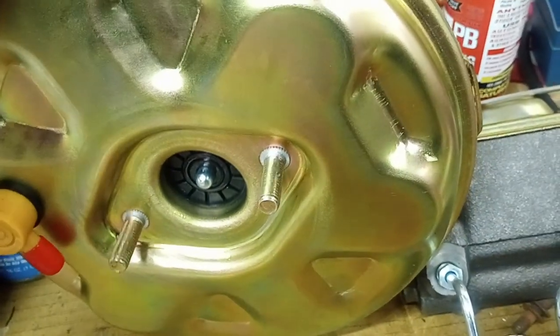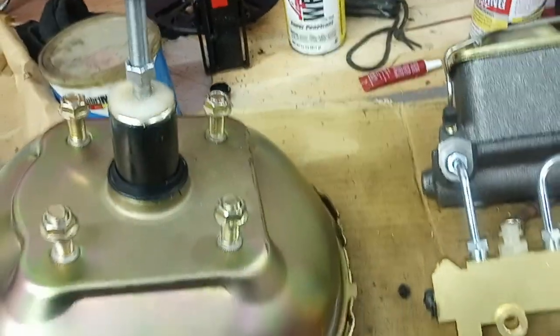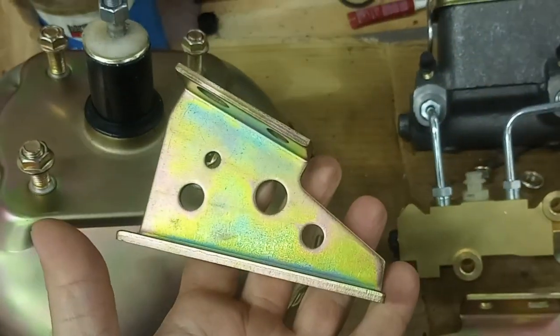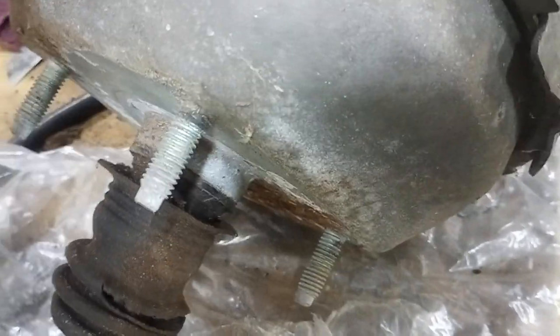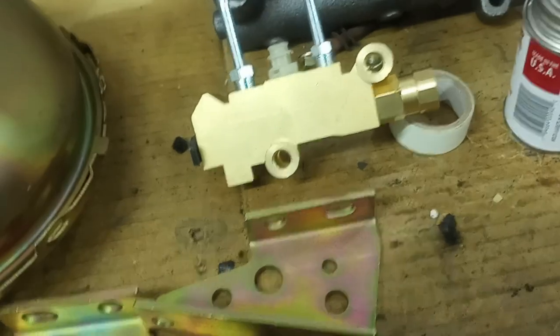And fit — I'd say it fits with an asterisk, because yes, it will technically fit, but there's a little bit of customization you have to do. Not a big deal. So the booster comes with these angled brackets, which I think fit some of the mid-sized cars. The Buick does not have a bracket — this is the original here, it's just flat. The booster is just flat against the firewall. So it comes with an adapter; you take these off, you put the flat adapter on, which is in right now, I'll show you that.